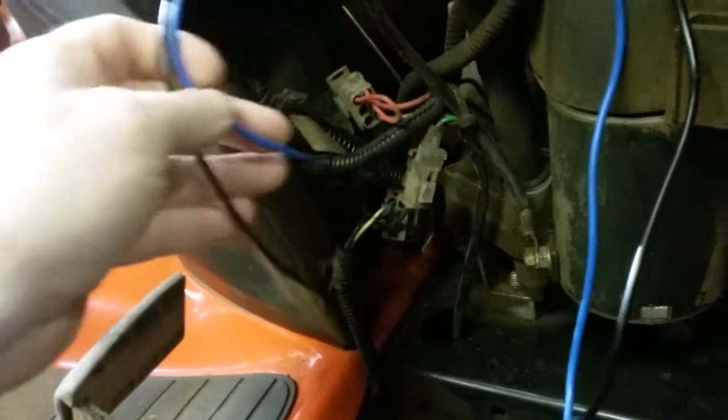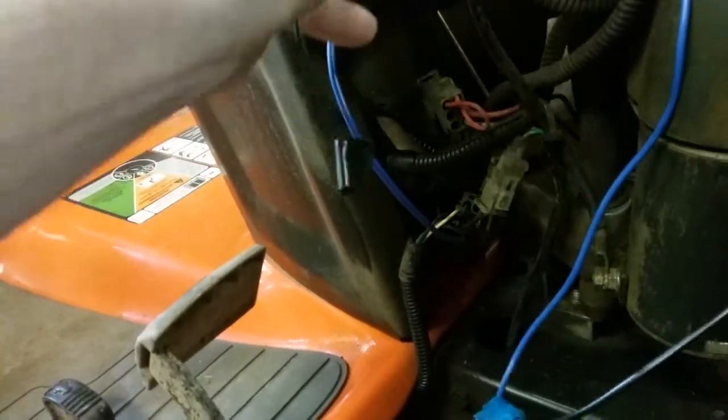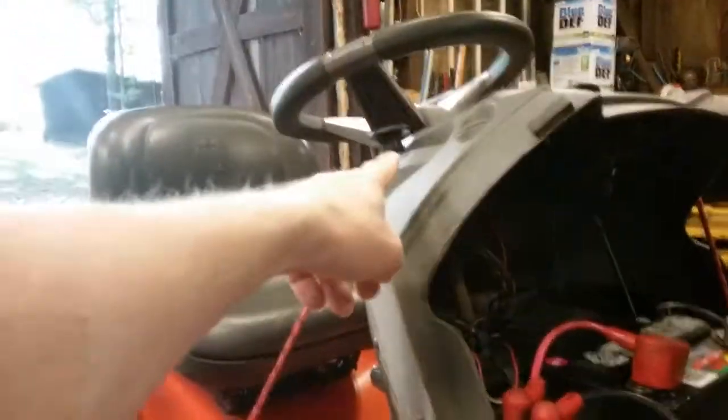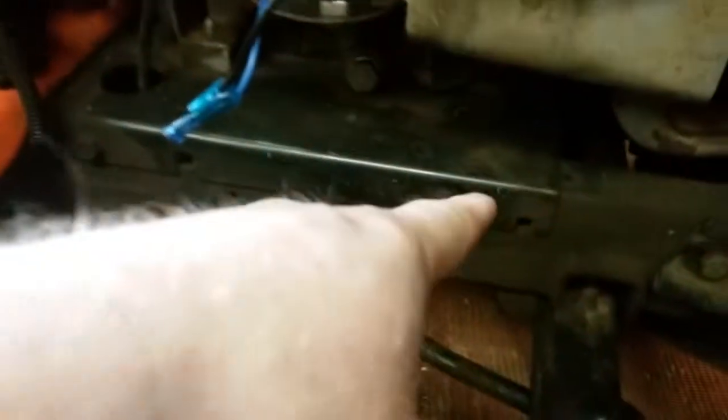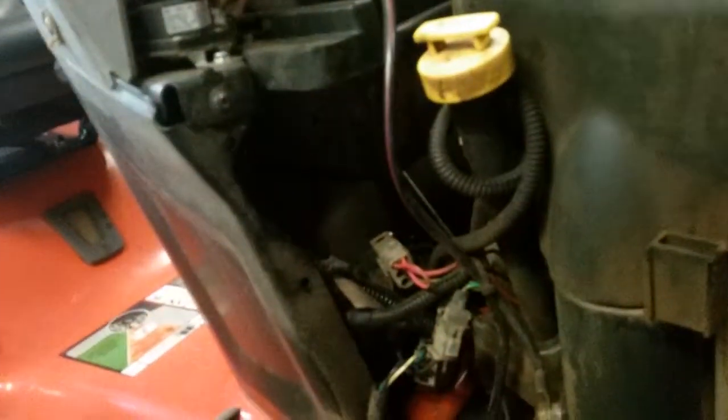We found out the PTO didn't freeze up. What we did was take this wire, put a 15-amp fuse in it as you can see here, and took the other end and wired it up to the red wires — just wrapped some tape around it. Once we did that, the lawnmower cranked fine. We turned the key on, turned the PTO on without the lawnmower running, and we heard it click on and off like it's supposed to. So we rigged this up — it's got coating on it so the connectors don't touch — and after wiring it in, everything seemed okay.